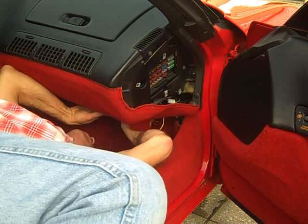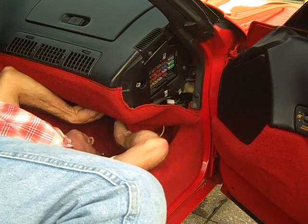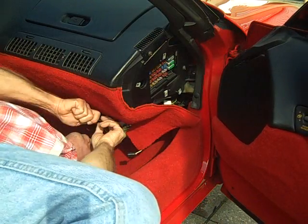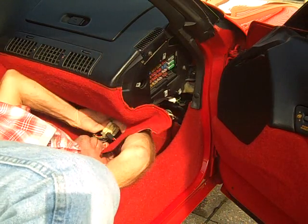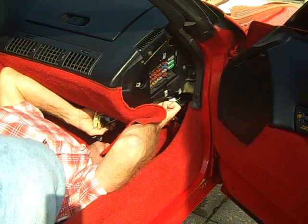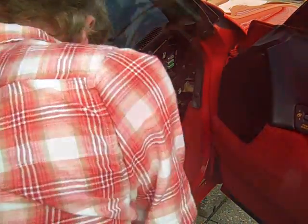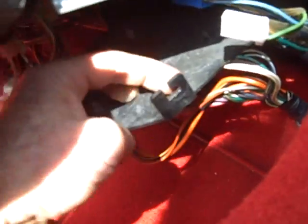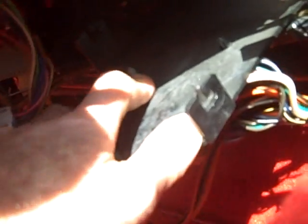If this video makes this look like an easy job or appears to be done in five to ten minutes, it is very misleading, because this is not an easy job. There is one 10mm bolt and a second 10mm bolt. Now this plastic plate on the bottom below the CDM has a little tongue-and-groove action going on on both sides. Part of the trick to removing this is to push this plastic piece to release and come down. We've released this plastic panel below the CDM — you can see where the groove pushes this panel back off of the screw that the 10mm bolt goes on and then down releases it through this little L-shaped bracket. This is on both sides of the CDM and will allow access.